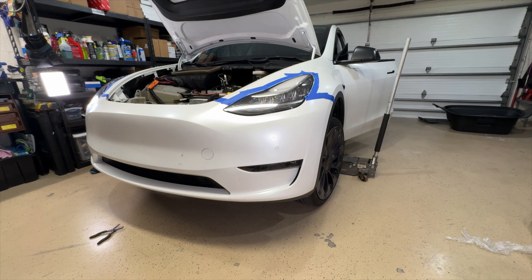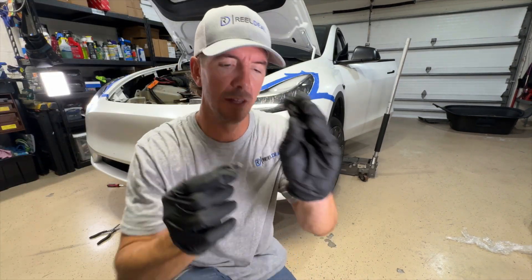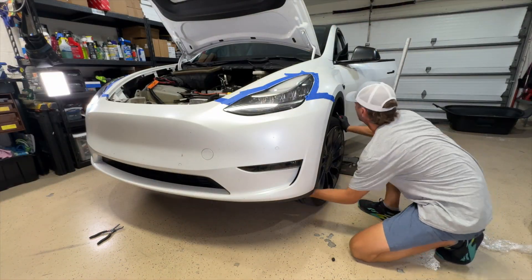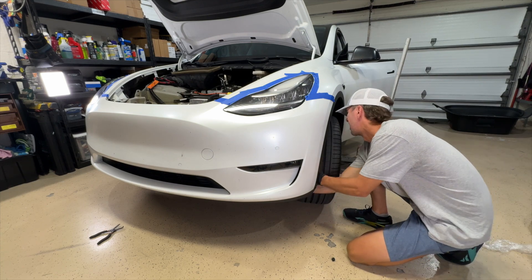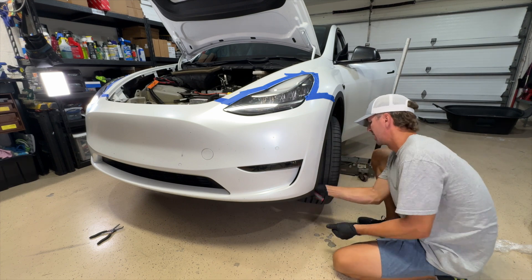From this point, now you can see I'm turning the wheels — you wouldn't be able to do this if the car wasn't jacked up. So turn the wheels and that way it gives me access to the three bolts and the three clips that are on that side. Those are the clips right there, inside the fender well. Now I'm going to do the same to this side — move the wheel out of the way, it gives me better access. Remove those three clips, and again the flat head screwdriver works best.